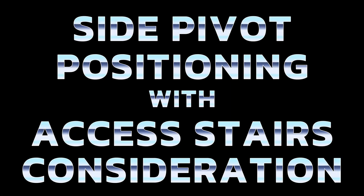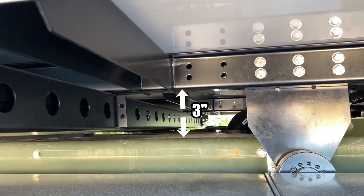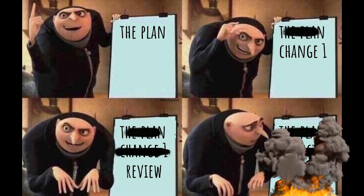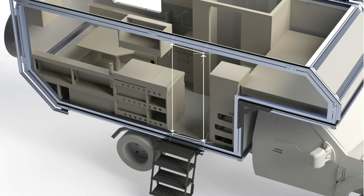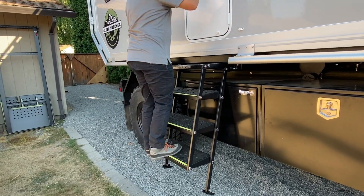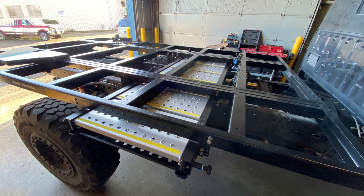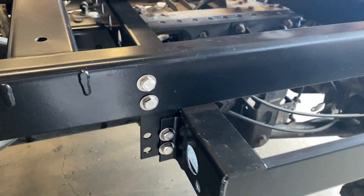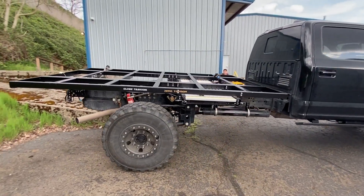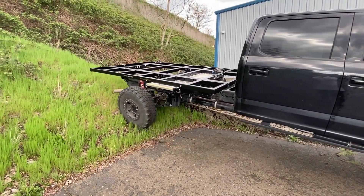Side pivot and crossmember positioning with the access stairs: on our subframe weldment in the middle and front, pivot mounting has a 3-inch on-center spacing adjustability to adjust for clearing your chassis obstructions as well as providing access stair clearance. Pre-planning is key. The position of your habitat door will dictate where your access stairs will be. Align the hinge of the door with the right side of the access stairs so you have more room on the handle side when opening or closing the door for ingress or egress. The access stairs will dictate where your side bracket pivots will need to be located — or more accurately, where they cannot be located. It is also necessary that the side bracket pivots be located fairly close to the access stairs so that frame twist does not compromise your access stairs by pinching them between truck parts and the habitat.